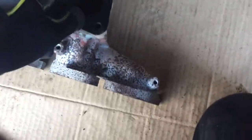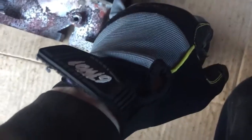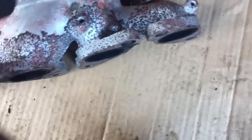I've taken the manifold off and you can see why it was leaking — the studs are completely sheared. I'll have to probably drill these out and tap them out, then make some better studs. I'm impressed with those little grip washers from a previous video — the ones that hold the manifold on — they seem to have worked a treat holding the manifold in place.